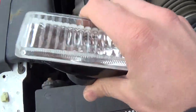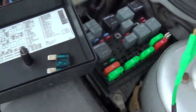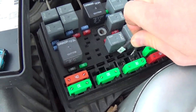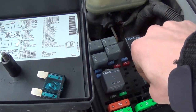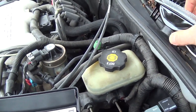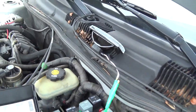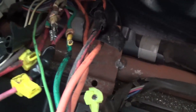So for now I'm going to remove this 60 amp fuse, and instead of that we're going to install a fog lamp. Now this guy is 55 watts, so it draws a little more than four amps — almost five amps at 12 volts. Let's plug that in here, make sure you have a good connection, and we'll point it right towards our window so we can see when our short is occurring. When that light's bright, that leg will be shorted to ground. As you can see in here, this is a mess — there are wires, just bare wires, spliced and twisted. I wouldn't be surprised if the problem was in this area since we have all these bare wires — might be touching metal somewhere or touching each other.